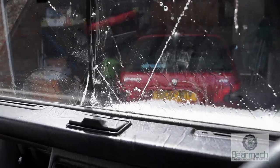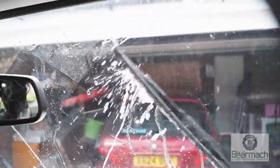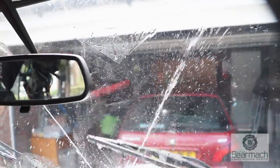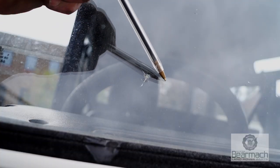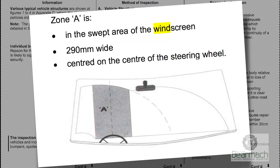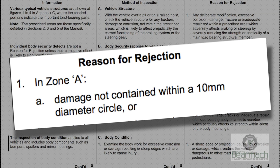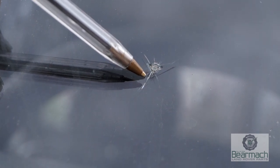The wipers should wipe the whole screen in the A and B zones. You can see these wipers are working alright. However, there is a stone chip in the windscreen which falls in prescribed zone A — a failure would occur if it's larger than 10mm in diameter, which is the size of a 5p piece. This chip is borderline but is starting to crack out.